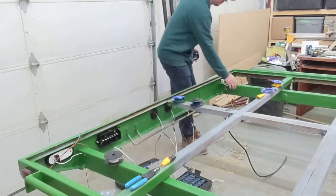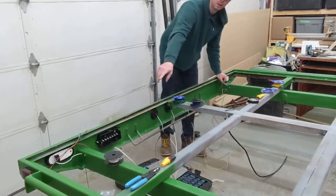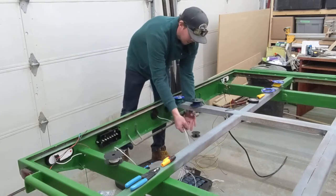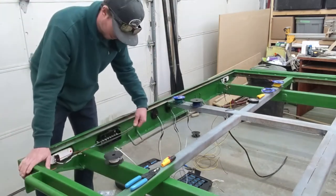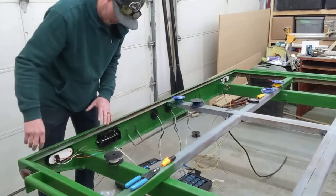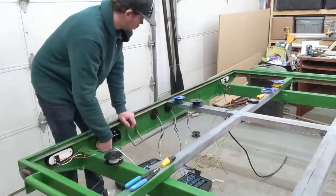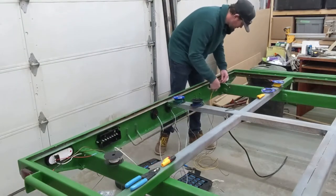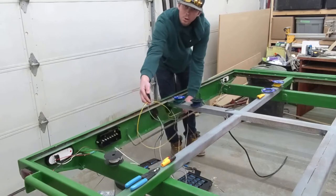Now that I've got all my color-coded wiring installed, I'm going to have three different runs of split loom tubing going to the junction box: one run from the left clearance light and tail light, one from the three running lights on the back, and one from the right clearance light and right signal/stop light. To keep the wires organized and get the loom on, I'll use a little electrical tape — a couple of wraps every foot to get the proper length and everything organized, then get the tubing on.